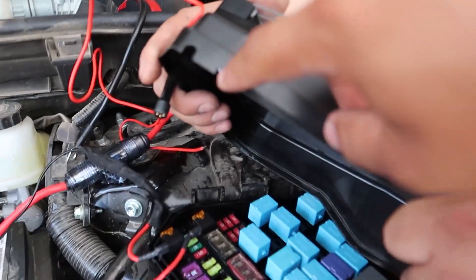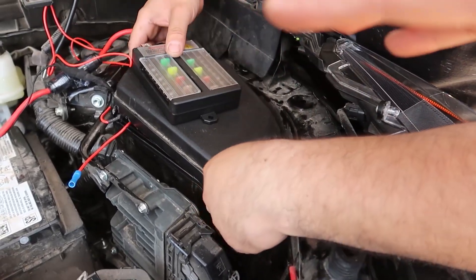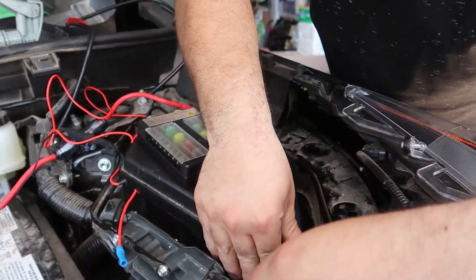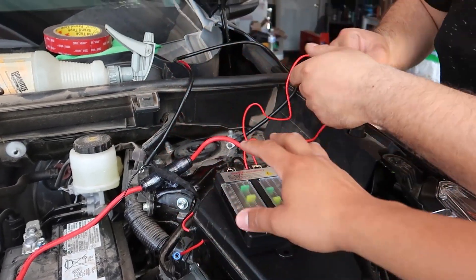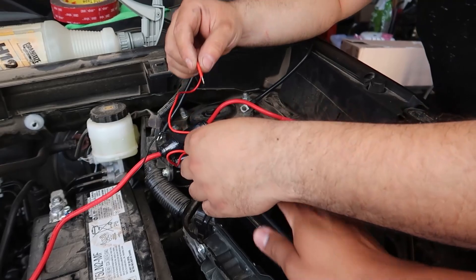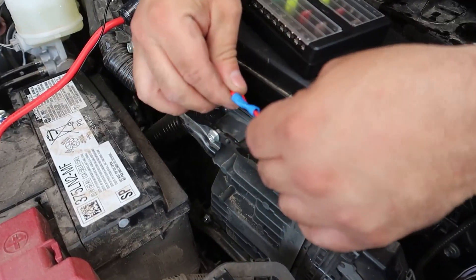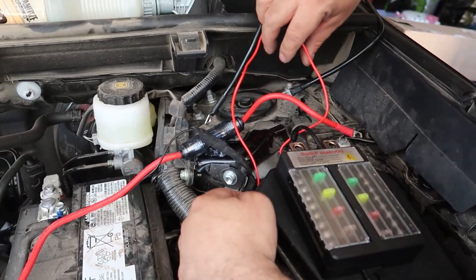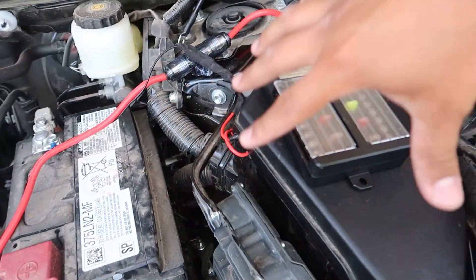Now we've chopped it up — we cut it here and then a little bit down there, little by little just to make sure you don't overcut. We're going to show you guys that it still closes. Super easy, nothing hard about that — there's still full closure and everything still clips in as intended. Up next we're going to get the added fuse wire and wire it up to this little box. The red wire is for the backlight on the actual switch panel, so you slide the wire right in, get your crimp tool, crimp it down, give it a tug to make sure it's secure. Then zip tie it away so it's not exposed and hanging. Now the added fuse is out of the way — zip tied and tucked behind here so it looks nice and clean.